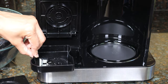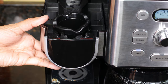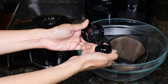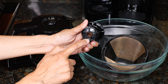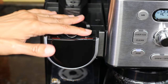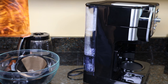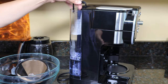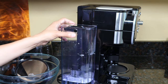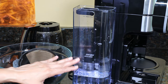The drip tray and plate are also top-rack dishwasher safe. If you need to remove the pod holder for cleaning, push up from the bottom, then twist the bottom away from you and pull off. If it's clogged, you can put a paper clip in the hole — left to close and right to open. Put the pod holder back after cleaning. The heater plate and the rest of the unit can be wiped down with a damp cloth. The water reservoir can be washed when needed using a soft sponge and soap — air dry it or use a lint-free cloth. Don't use a regular cloth inside the reservoir as lint could get in. If you're using their filter, remember to remove it before cleaning the reservoir.